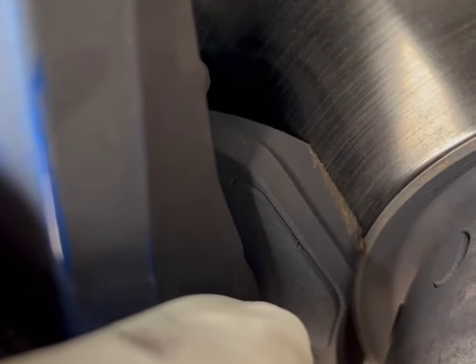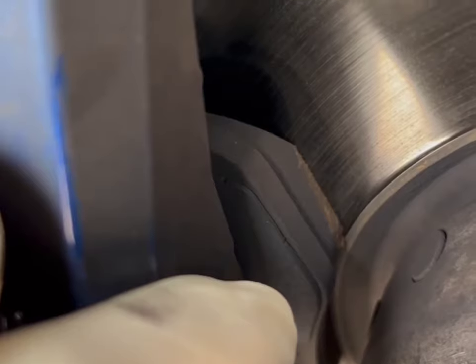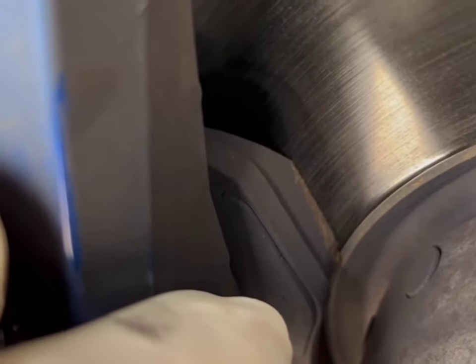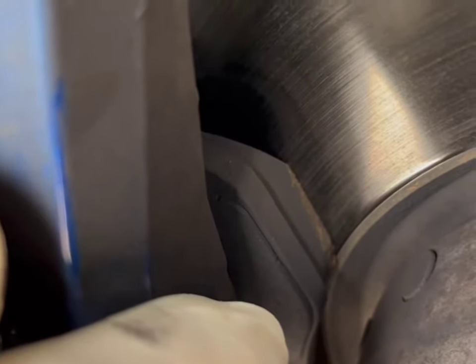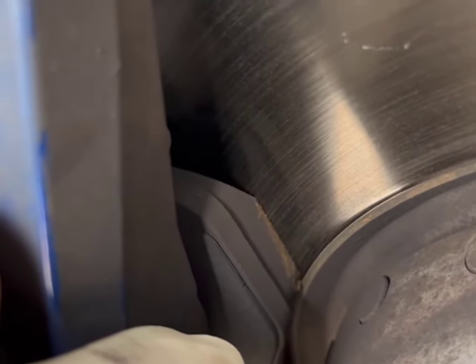This looks to have about four millimeters left. These brake pads are going to be needing replacement soon. About 20 percent pad life left is ideally when you would like to replace your brake pads.